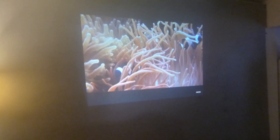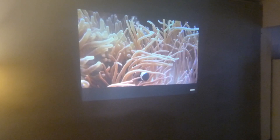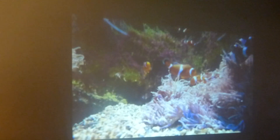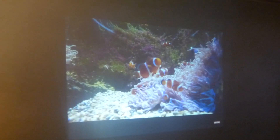The farther back that you have your mirror, and the more of a slant you have the mirror on, the bigger the screen is going to get. Now mind you, when you slant the mirror, you're going to have to use your keystone to straighten it up. Do not have automatic keystone on because it will become a problem — you have to do it manually. And you guys, you see you don't lose any lumens, you don't lose any color. I've done it on projectors as low as 300 lumens.